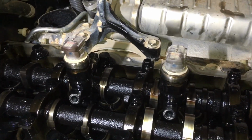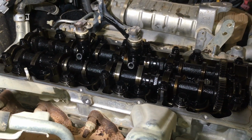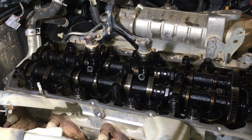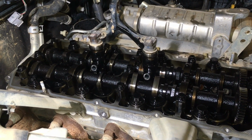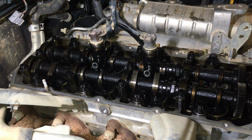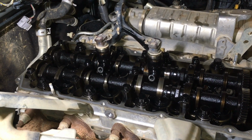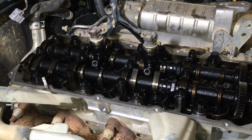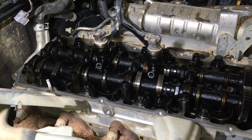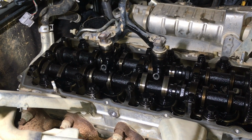And it doesn't look like these injectors have been out for at least 13 years either by the looks of them. And remember how many Ks it had done? Do you remember from that video? Because I don't remember. It was 220, getting close to the 230 though. And you know 230 is the danger zone. You know how we say, change them at 170-ish is probably safe for the older vehicles, 150 because the injectors aren't as good as the later ones. You can stretch the later ones, 170, 180, 190 a bit. You can go to 200 if you like, but don't push it too far. And I wouldn't be going over 200 because this is what you're going to end up with, okay?